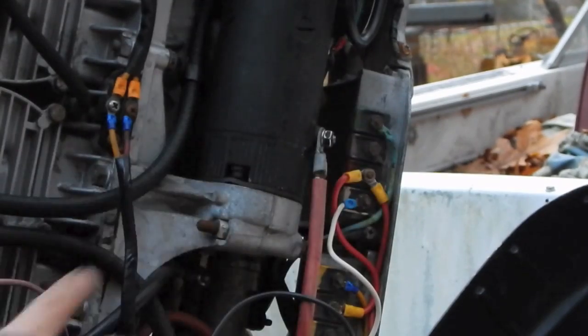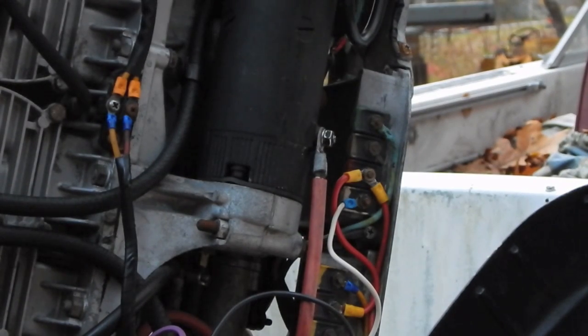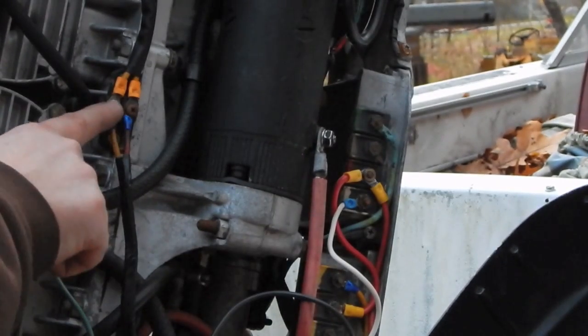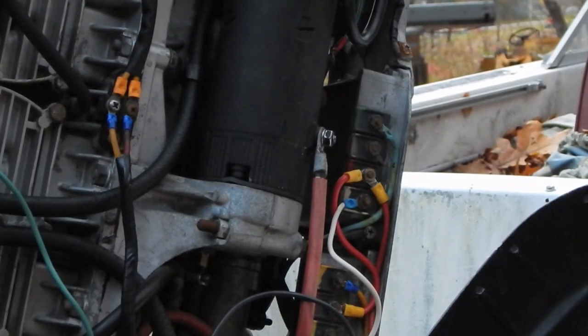But in the actual application of this motor, when I was taking it apart, I'm pretty sure that's where this tachometer wire went, which is kind of weird. So, I don't know. According to the wiring diagram, the tachometer wire is supposed to go to one of these alternator connections. So apparently it's supposed to be using a pulse from the alternator to determine the RPMs. Strange.